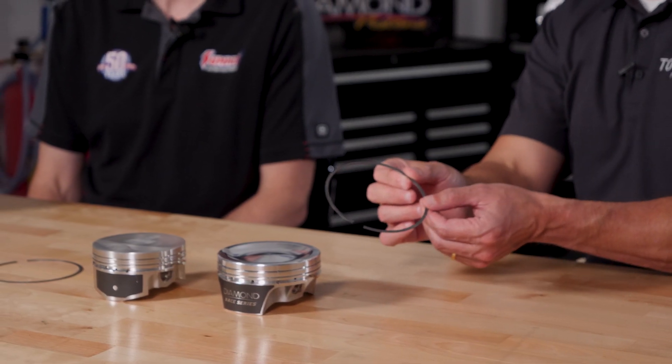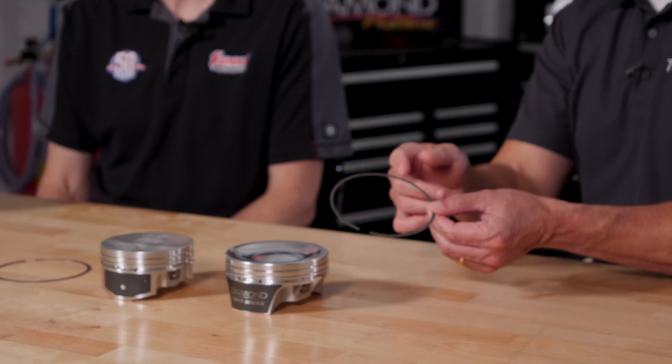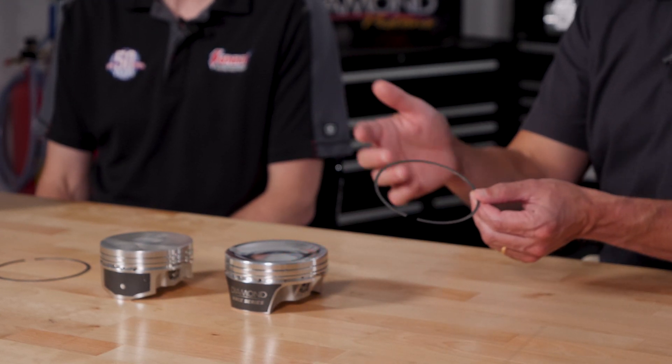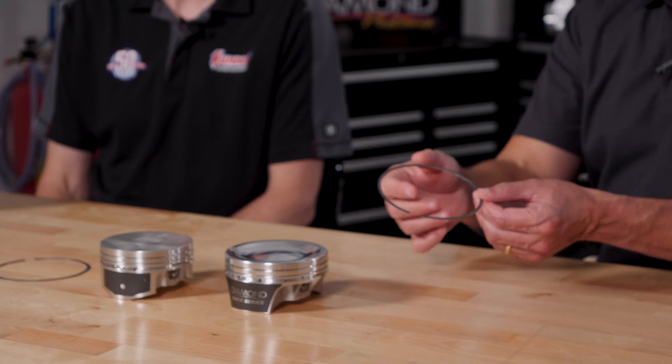So if you can't put it in the piston, let's try putting it in the ring instead. Once we started putting gas ports in the ring, we started to learn some things — that actually, the gas ports in the ring weren't just better than putting gas ports in the piston. It's cool technology, because before it was always said you couldn't run a gas-ported piston on the street — they carbon up and do this and that. Well, the reality is this gas-ported ring solves all those problems.